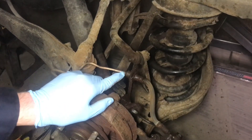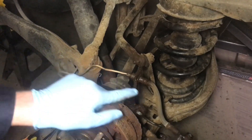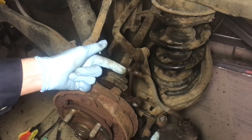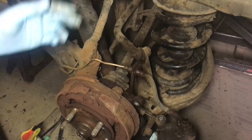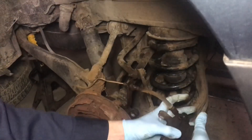What's happening is that this nut isn't spinning separate from the metal brake line. So I'm probably going to just spin the caliper — just twist it like this — take off this clip, and spin it out that way rather than trying to twist this and end up twisting the brake line and breaking it. Got this clip off. Now I can just spin the caliper off.